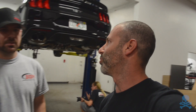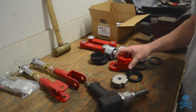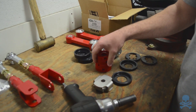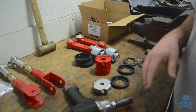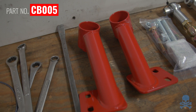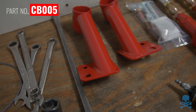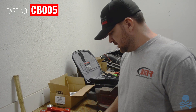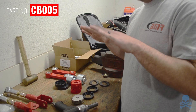I'm going to take you over here and look at some of the parts that we have. Kelly's going to explain what we've got and what we're going to be doing. Basically, we're going to do the basic items that pretty much everybody wants to do on these cars, whether it's an NA car or you're going to end up putting a Whipple in there. First and foremost, our most popular product is going to be the Cradle Bushing Lockout Kit. This is about a 45-minute install, even for your average person. It comes with rings to lock out the top of the cradle so the cradle doesn't deflect when you go wide-open throttle.